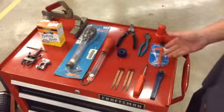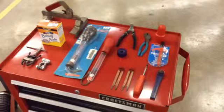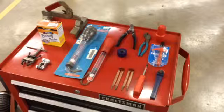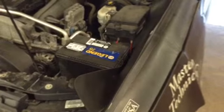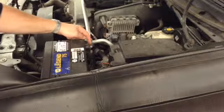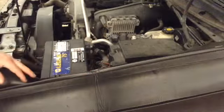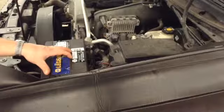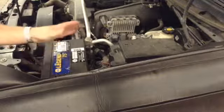We have another hydrometer. It just looks a little bit different, but anyhow, the goal here is to get all of the acid that accumulates from the battery off of the battery. And when we're looking at it in a car, usually this is going to show up as a lot of that green menace, as I like to call it, okay, especially here where we live in the Northeast. That corrosion is going to build up right around either terminal, be it negative or the positive one. It doesn't really matter. And so what we'll do is we would remove the battery from the vehicle and take it to an area to clean it and get rid of all that acid buildup.